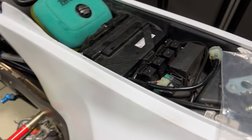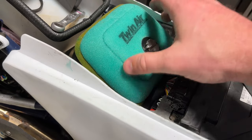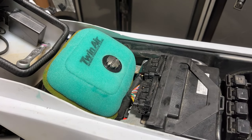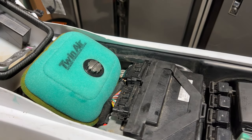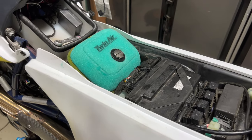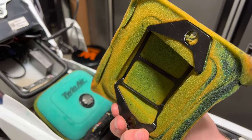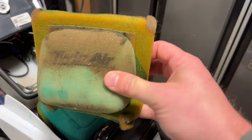The filter does come pre-oiled. You should clean it — I'd say follow a normal dirt bike interval. It all depends on your dust setting; give it a visual glance. Mine was getting dirty at about 500 miles without being cleaned, just to give you an example, but this was mostly road riding in this case.